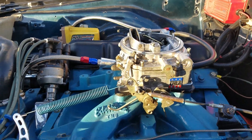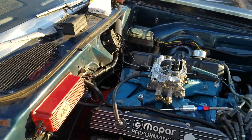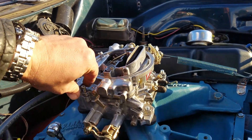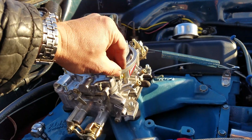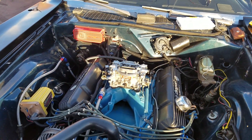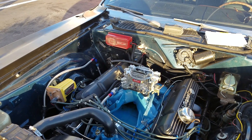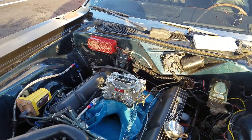I love these carburetors — you can open them up without fuel going everywhere, and they're just as adjustable as any Holley for most applications. At 400 to 500 horsepower, this is the carburetor to go with on a daily driver because it's just not going to start fires and it'll run well if you set it up properly. A lot of people who complain about them have never taken the time to set them up, or they daily drive a fuel-injected car and only have a trailer-queen track car. Take their opinion with a grain of salt.